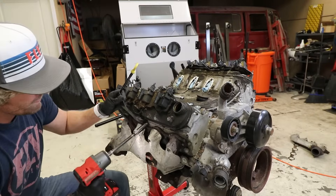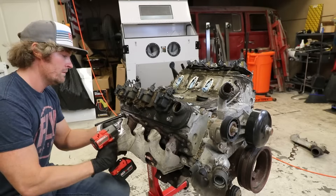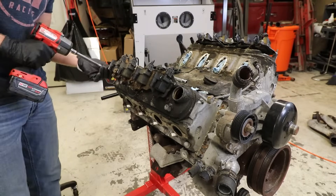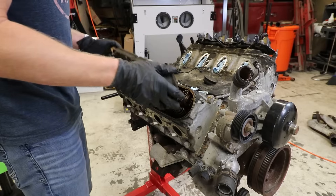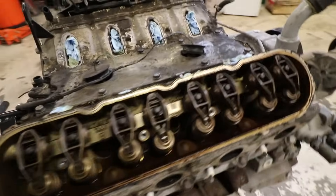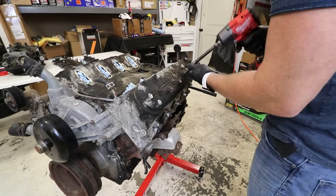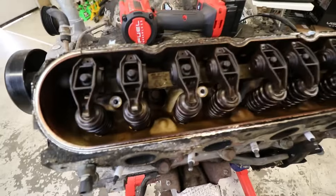So this time we need to go ahead and take the dipstick off first. Now we're going to be pulling the coil pack harness and then we can go ahead and pop the valve cover off. The valve cover gasket has definitely been leaking - it's pretty hard. I'm extremely impressed with how clean it is in here actually. Whoever had this actually took care of it - this looks really good for 300,000 miles. The other side is extremely clean as well. Yeah, whoever had this actually gave a shit.